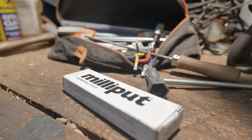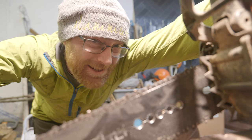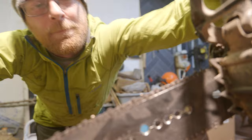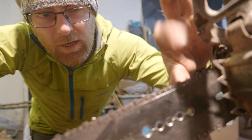We drill out some holes, we're going to cut between them, get the Dremel on them, make it all nice and neat, and then shove in some Milliput epoxy. Then we'll sand it all really nice and flush, nice and polished. Should be significantly lighter when we're done. We're not taking that much metal out, and we're putting more weight in with the epoxy, but we need that so that as we're cutting it doesn't pick up dust from the underside of the cut and clog up all the holes and create friction.